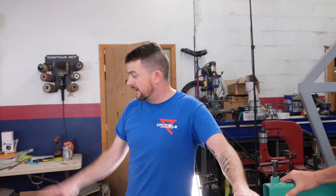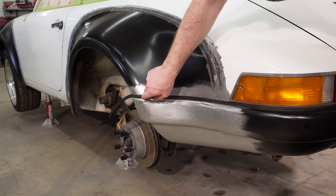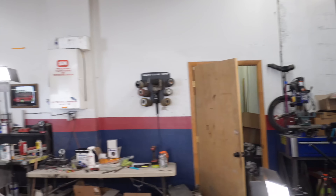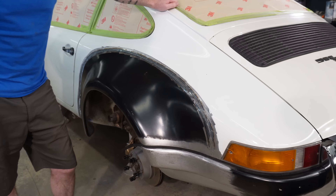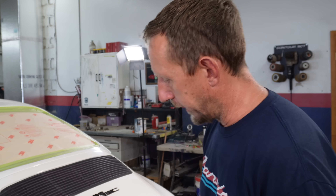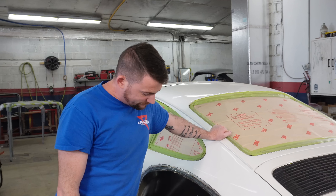We're not done yet by any means. The bumpers are where they're supposed to be on the car, but we have not made mounting points yet for the front halves of the bumpers - they're just clamped up with Clecos right now, and they're sandwiching the rubbers in by friction. There's actually supposed to be a channel for the rubber to clip into, so we get to fabricate a metal channel for it to latch to. We also need bumper supports on the inside. For the valances, we have to modify those, beef up the bumper brackets, and fill in the holes for the trim we're not putting on. I intended to get to that point this week, but it didn't happen, and that's okay. We'll roll into the next time we work on this thing.